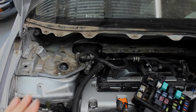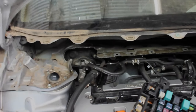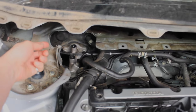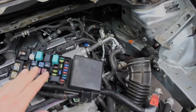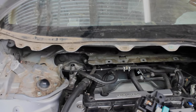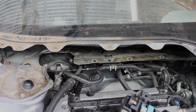Now we're jumping up into the front, into this brake area. I haven't really explained much about this big hole, but as you might remember from the last episode, I drilled this hole here to pull that big wiring loom that comes up here and along and then down into the fuse box. Fuse box sitting up here, but it runs down into there. So I did that, everything was all good. Then I started playing with the brakes and realised that changing the booster, changing the brake pedal, changing the master cylinder - I ended up with the remote reservoir that's on the Odyssey not working.